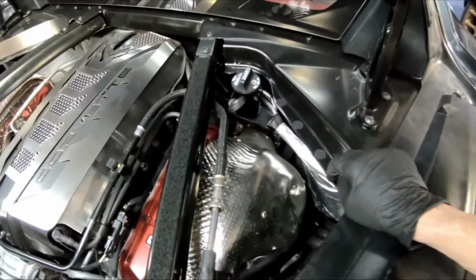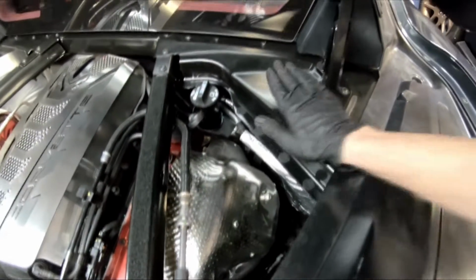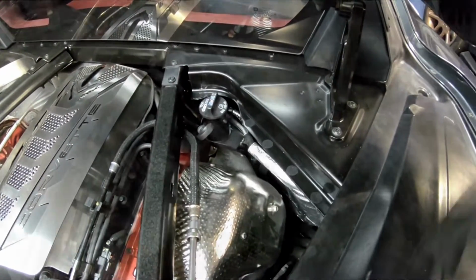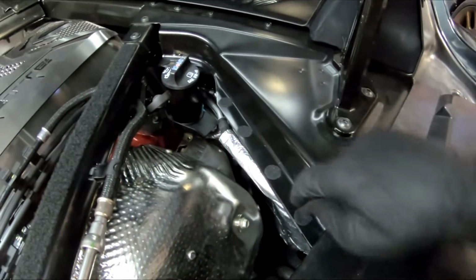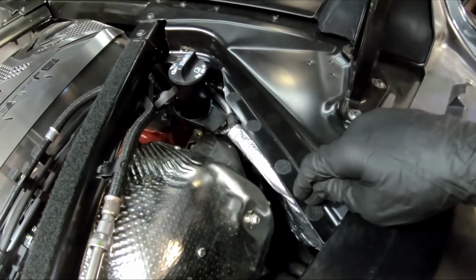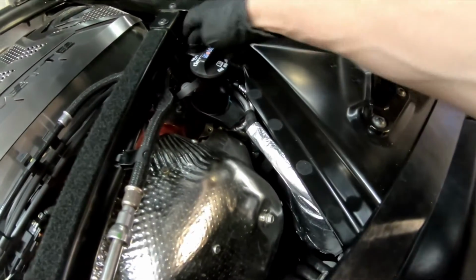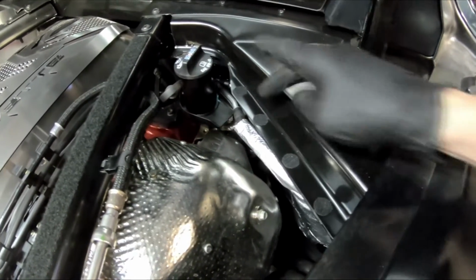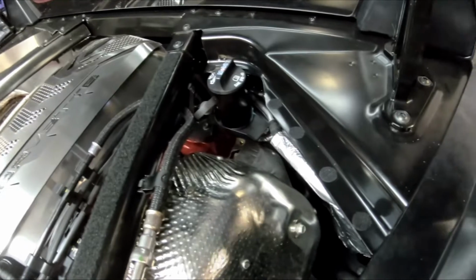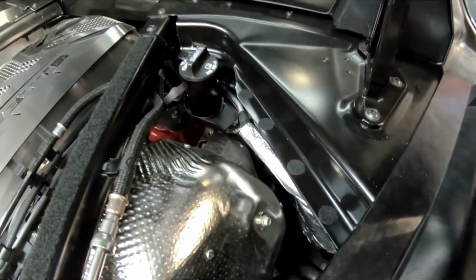Going to show you today is how to put in the exhaust heat shield covers that attach pretty much right along in here, and then we'll also have this back cover for you. The first thing you'll want to do is clean this surface and prep it with rubbing alcohol 5900, and then what you're going to notice is there's little weld marks all along this on both sides of the car. This is where you're going to stick your little 1/2-inch Velcro cookie, because these pieces are meant to be removable, so there's no drilling or anything required.